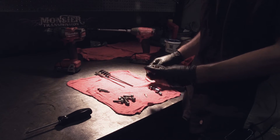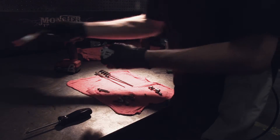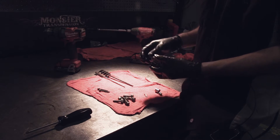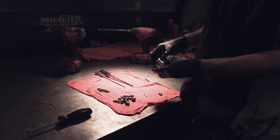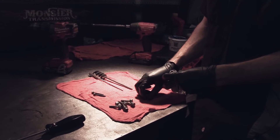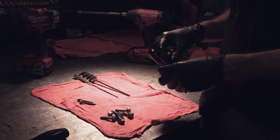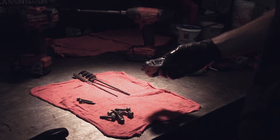For reinstalling or reassembling the governor, take your newly cleaned part and apply a little ATF to it — a little lubricant. Make sure you're putting it back in the exact way it came out. Give it a little shake just to make sure. Put the screen back in and then you're ready to reassemble the governor on your transmission.